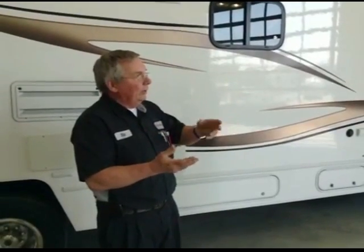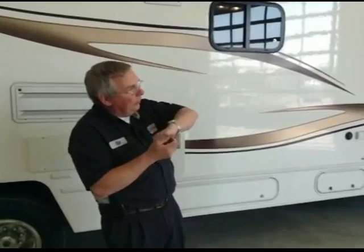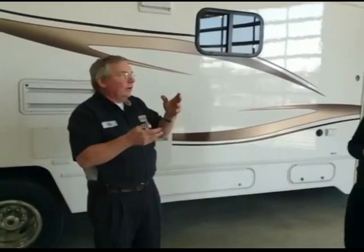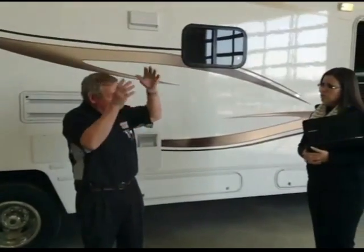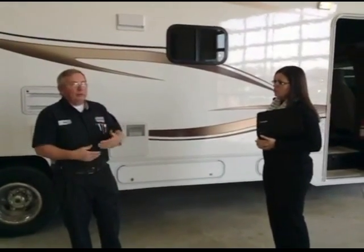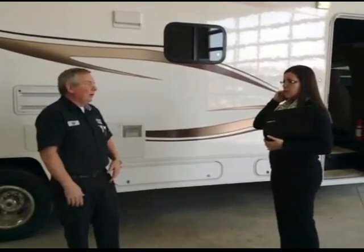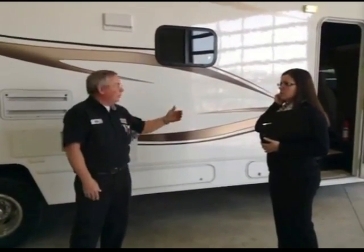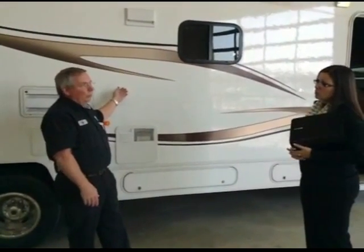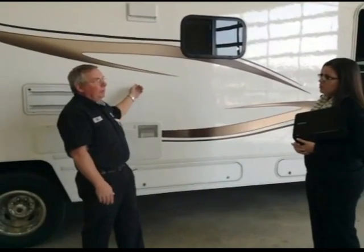Anytime you winterize a residential refrigerator, if you don't want to run your pink antifreeze through and you're running air pressure to blow it out, leave the refrigerator turned on. Leave the air in the lines. All it's going to do is blow all that water out of the lines, and you might make a little bit of a watery mess in your freezer as it spits out into the freezer. Sure. When it cycles, it's going to spit that air and water mixture out.